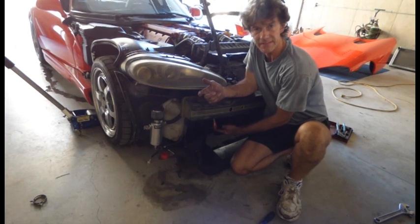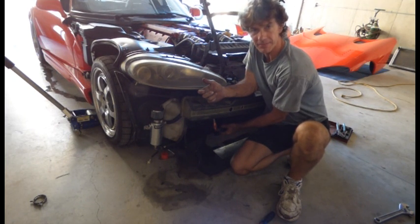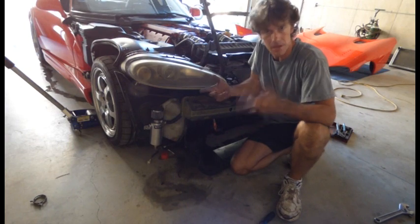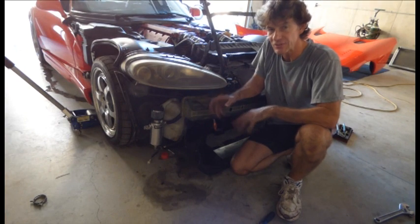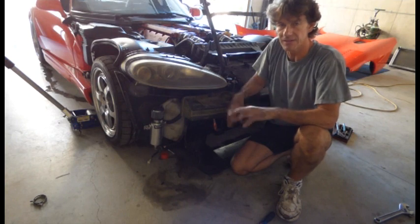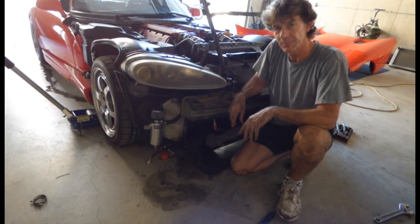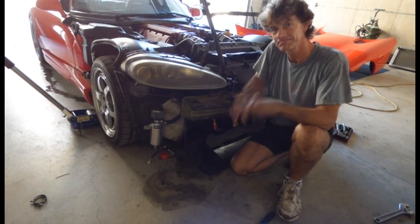I've got an oil leak in this swivel fitting here, so I have to order another one. I'm not going to put my bumper cover back on until I get this new fitting installed — to do so I'm going to have to remove the hose from the engine. If you don't need access to your oil cooler, you don't have to remove your bumper. You can get to your radiator just by removing a couple of nuts in front and pulling off the fan assembly, and the radiator should pop right out pretty easily. I hope this gave you some insight on what to expect when you're ready to replace your radiator. This is a DIY job you can do at home — it's not a big deal. Thanks for watching.